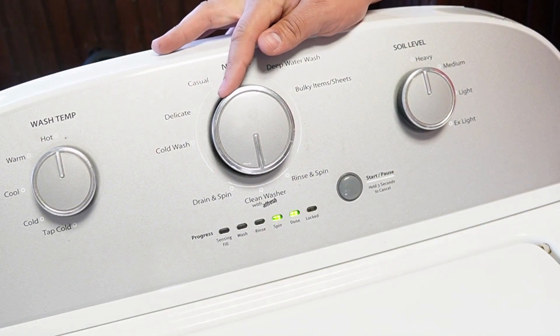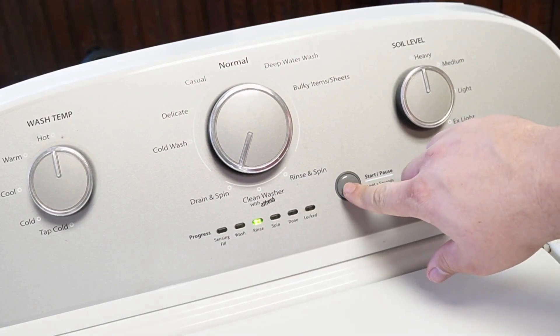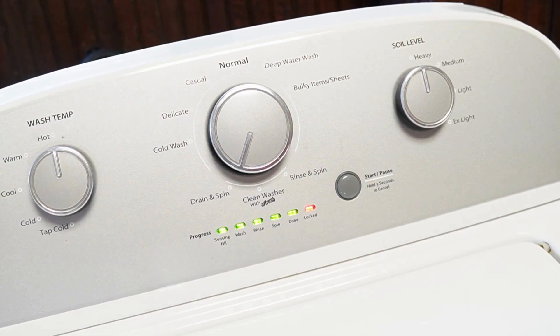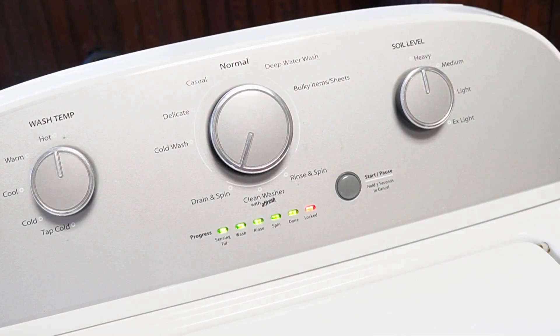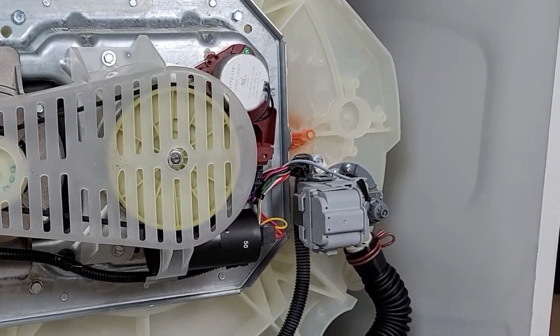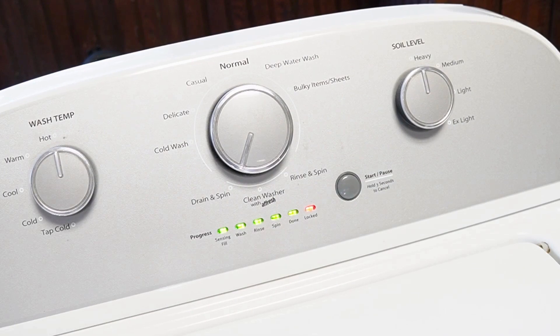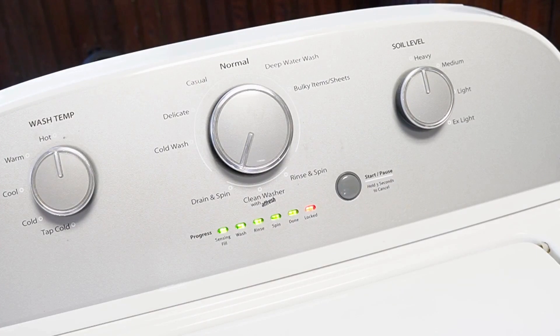Once you're in this mode, turn the knob clockwise four times. The rinse light should be the only one illuminated solidly by itself — this is the recalibration mode. Once you press the start button on the rinse mode, the door lid will lock and it will begin a series of tests and operations. All these tests take approximately three minutes to run all the way through. As the recalibration mode runs, every part and process on the washing machine is going to be run, and the machine will physically reset all the components to a default state, allowing them to run at an optimal level. This is a must when parts aren't working right or the machine doesn't know what state it's actually in — like after replacing the shift actuator or a control board. During this time, you're going to hear all kinds of noises from the machine, and that's totally normal.